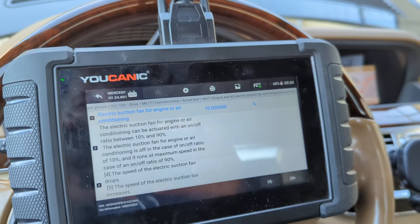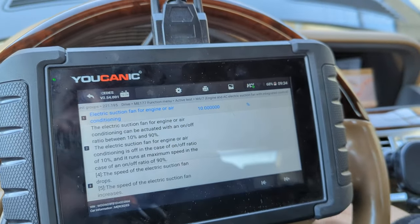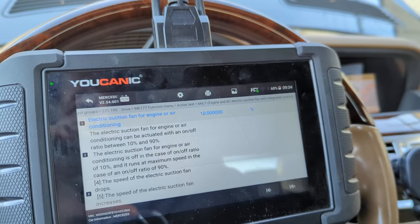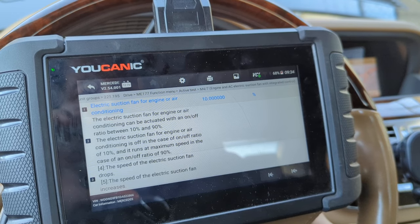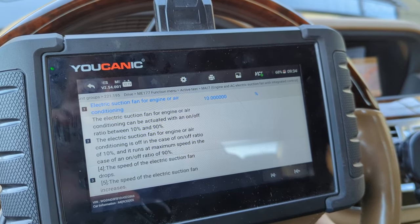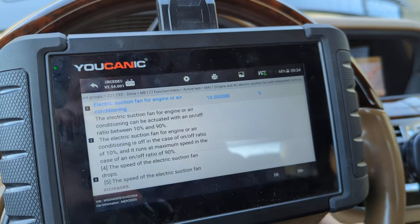It says lower limit is reached. One thing to keep in mind: ignition needs to be on, but the engine does not need to be started. Ignition does have to be on — your dash lights should be on when you are running this test.